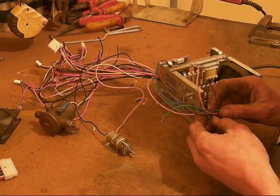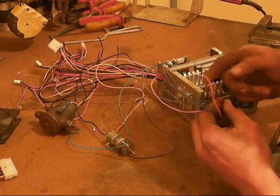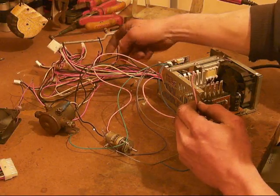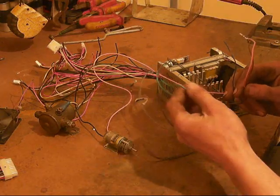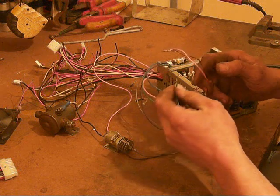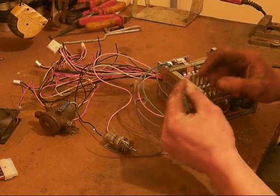When I took it out I was greeted with five wires. Some of the wire colours are the same as the other unit. The purple wire is actually thicker than the one on the old unit. The brown wire was connected to an orange cable, which I know is the 3.3 volt output. I also had a blue wire and a green wire. On the old unit I had to cross the blue and green, then switch between the purple and brown to switch it on and off. I tried that combination with this one and it didn't work. I tried cutting the brown wire off the orange wire it was fixed to and still couldn't get it to work.